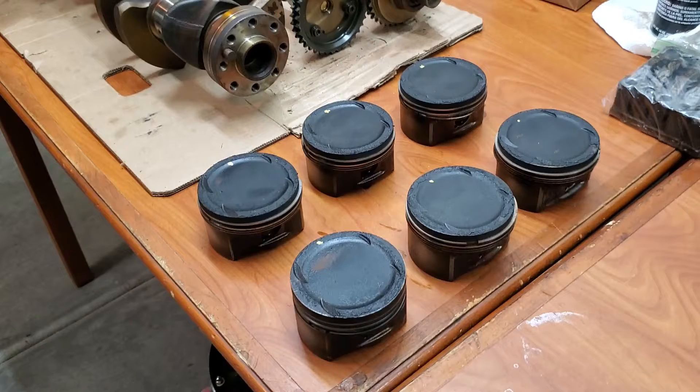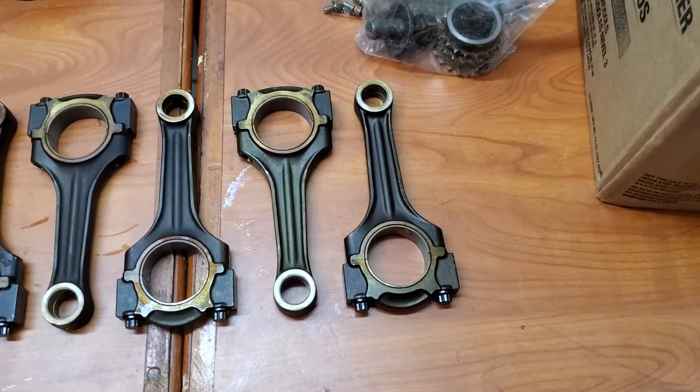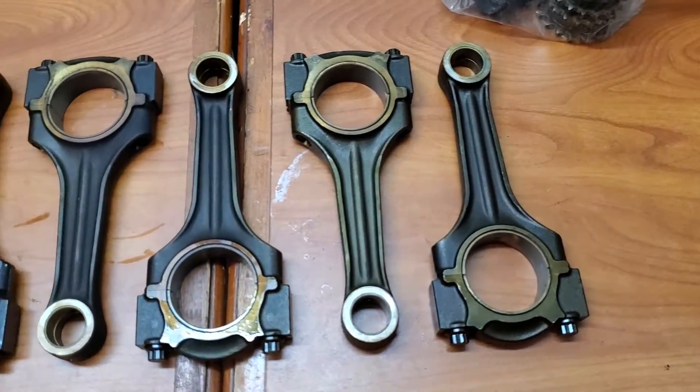Next is the pistons. In my case the dry lubricant coating has partially been worn off and there's a little bit of wear on the sides of the piston. However, I am going to reuse these pistons — I'm going to recoat the skirts and put a ceramic coating on the tops of the pistons. Check.